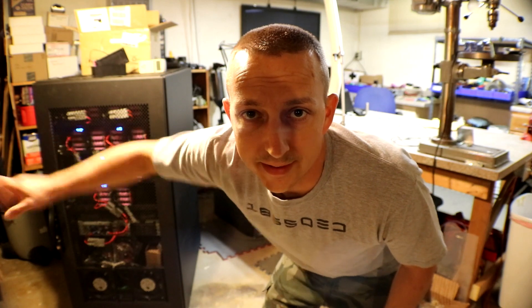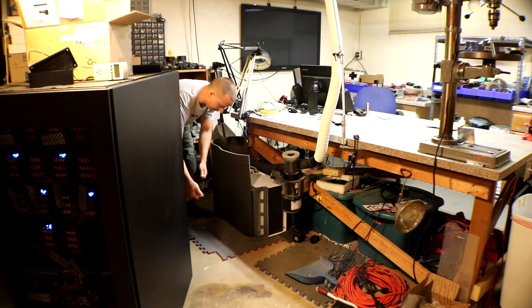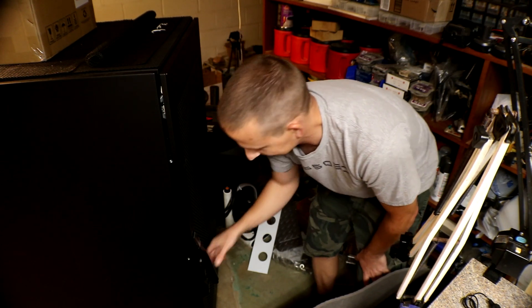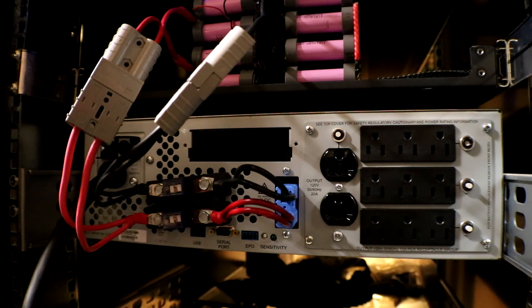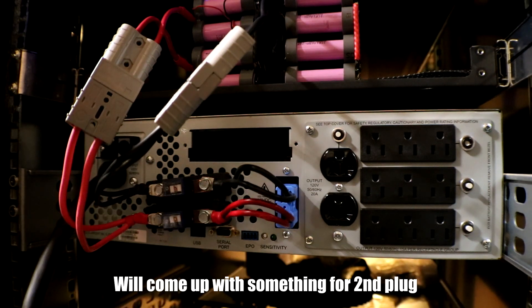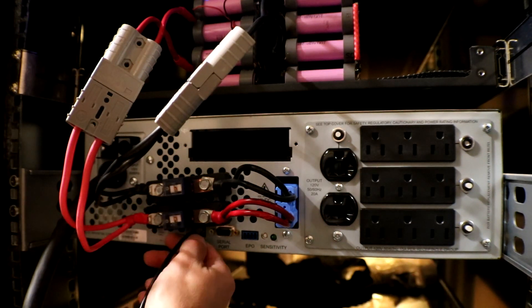You can't look at any of my mess on this side or any on this side. It's kind of a tight fit over here. I did have to do one quick modification. The Anderson plug that was in here before was a bigger plug and I didn't have anything to match it. So I pulled the one out of the front and zip tied all the wires in place on the inside, then put in a blue Anderson connector right here so I can use this back port. Now I don't have to have any wires coming out of the front. I will end up doing something to cover up these fuses because they're a little exposed right now.